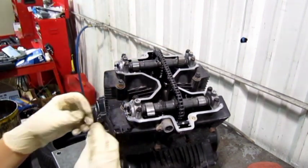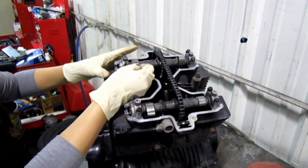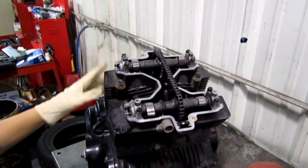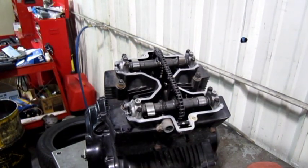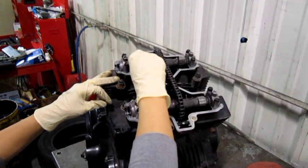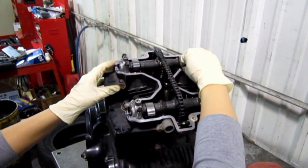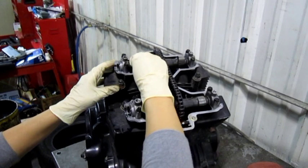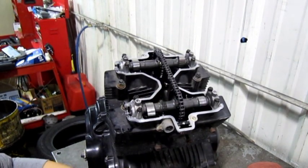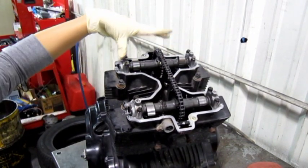On our intake, I'm going to do the same thing. This one doesn't fit and that one doesn't fit either. Just keep going down until you find one that fits. If the lowest spec doesn't fit, you'll know that you'll need to go ahead and change those shims.